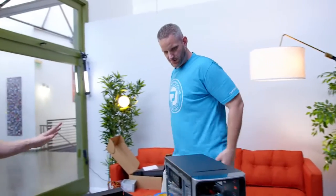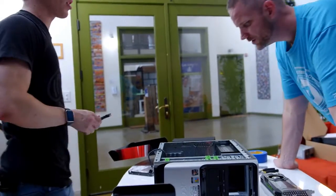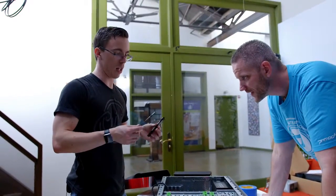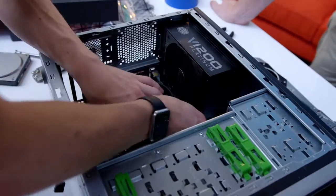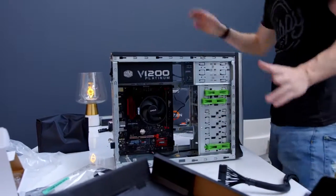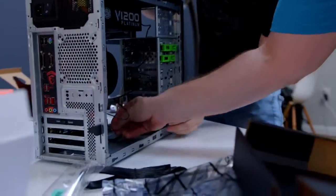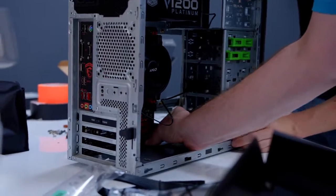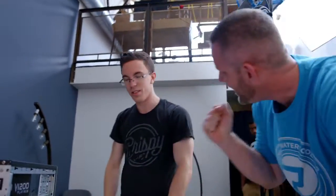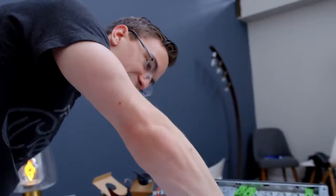The only other thing is going to be cooling, but let's get this all up and running and then we'll figure that out. Since the Scrapinator is accidentally becoming kind of cool, instead of using a one terabyte hard drive, we're going to be using a Samsung 950 Pro. Now we have an NVMe SSD. This is the only part that I'm actually a little nervous about — I know Ryzen has some issues with memory, especially when you get higher clock stuff. Worst case scenario, we just do one stick. And there we go — this is looking like an actual system. That front panel connector is proprietary to the other motherboard, but it has the exact same pinout. Everything about this build is so close that we're barely making it — there's not any slack on that whatsoever, but it fits.